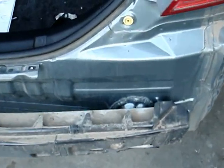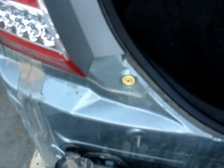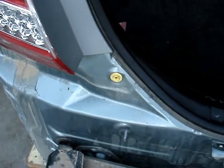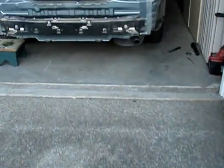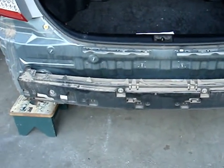and there's also two screws here. This yellow area here and this yellow one here. Those are removed by flipping open a little plastic tab on the bumper in this location here. Those are accessed through that little tab. So on each side then you have three little screws that have to be removed, and in the center two of these plastic tabs. So once you've done that,